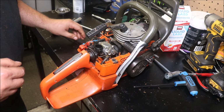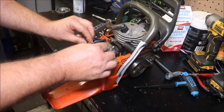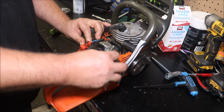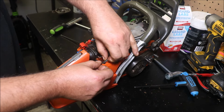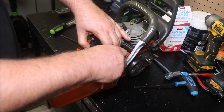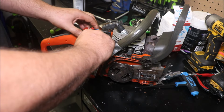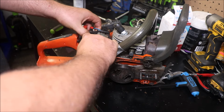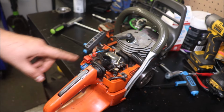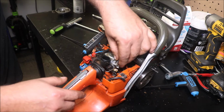Let's see, guys. Get the carburetor stuff loose off of it. I'm thinking this one might have had some issues with the kill switch as well. We'll just have to see. I ain't 100% certain on nothing about it. I remember firing it up and having to really, really richen up the low jet to get it to function properly. And all I'm doing there is, you got a grommet there and a grommet there. To put those back on, you just fish a pick or a little screwdriver in and pop them back on.